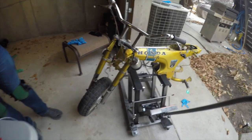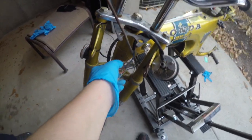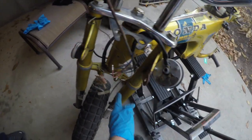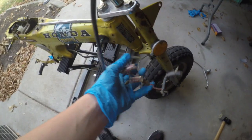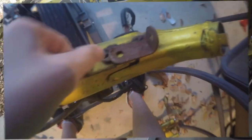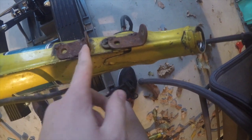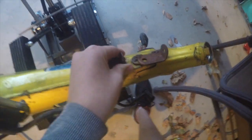So now what we did, we took the headlight off, messed with some of the wires, and took the speedometer and horn and the front fender off. We've started to take the wiring harness apart, and we've taken the throttle cable off. We're going to grind these crappy welds off.